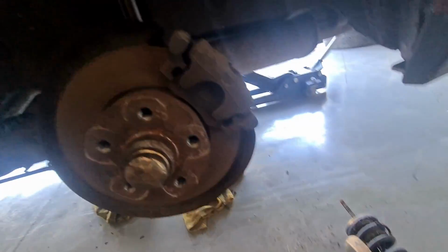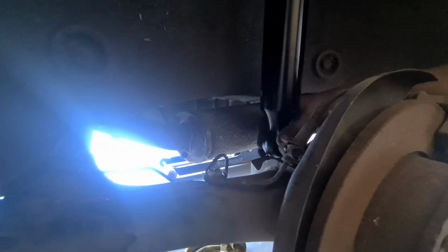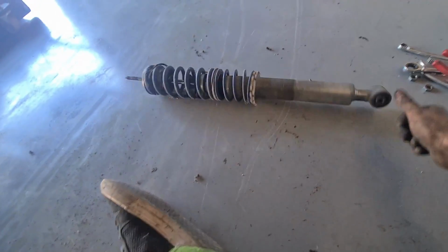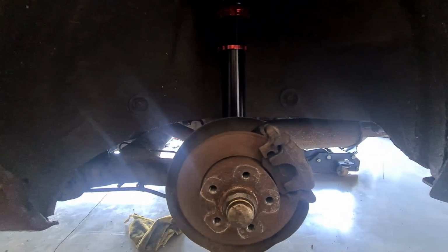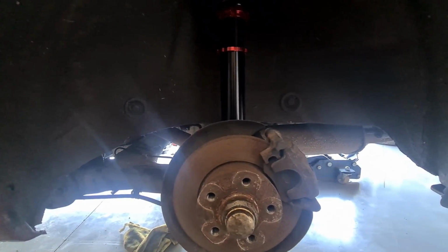Alright, so I just did the other side and it was a nightmare because the fuel tank's in the way. This side is in and the exhaust is kind of in the way, but we might be right. And this is the old coilover. These were very cheap, like $300 a set, and these were about $1,300 a set, and they're much nicer. They're BCs. So I'm just going to get that bottom bolt in, adjust the height roughly, and I'll match the other side that I had to pull apart, put the wheel on, and I'm done with the underneath. So it can roll on 5 studs for the first time, which will be pretty cool. So let's get that bolt in.